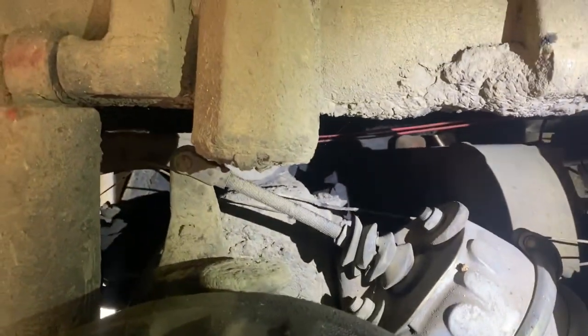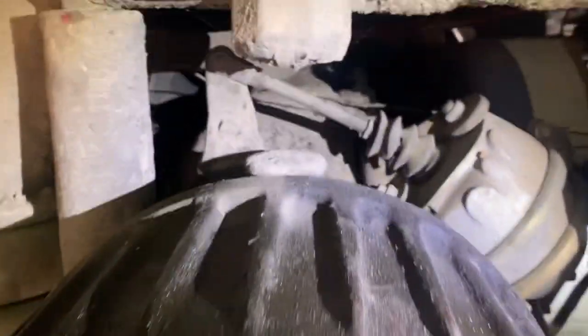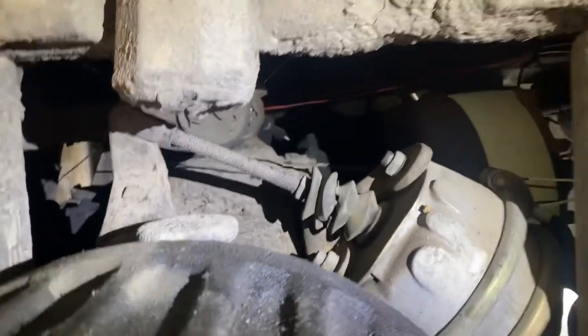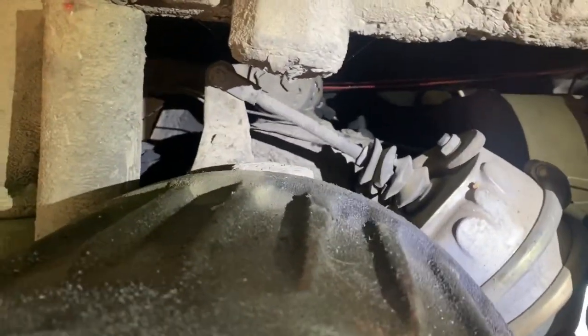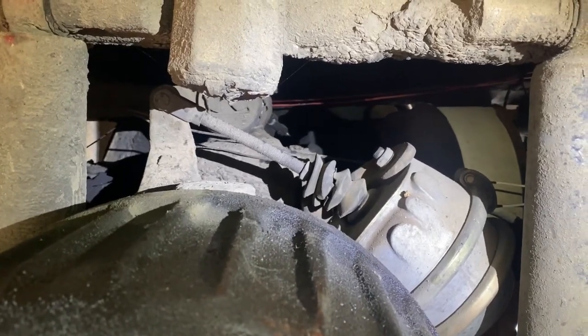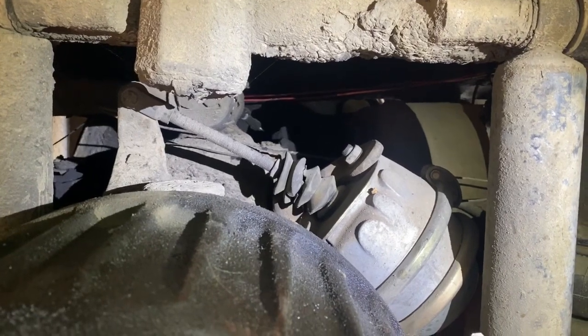It's full on out. But now I need to get this brake drum off with the brakes applied. I'm gonna try to back that slack adjuster off enough where I can get some there with that max travel. And there's even a little bit of a bend in the push rod. It's all the way out. Otherwise I could try to have him release the parking brake while I kind of jimmy that with a pry bar to try to get it to go back in at its right angle. But we'll see what we got. We'll try it with the slack adjuster first.